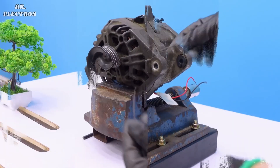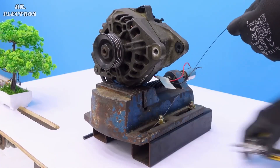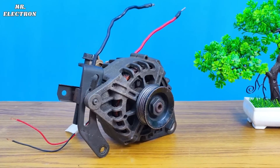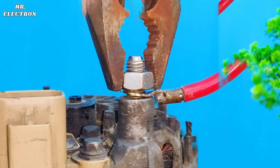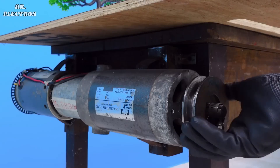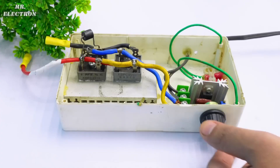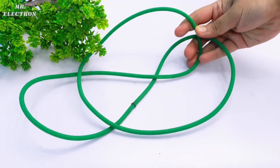Now let's install the alternator on the vice strongly to avoid any possible accidents, and at the same time use other kinds of lockings to prevent any possible alternator slippage from the vice. Here is some important information before starting the test: number one, the alternator is rated at 12 volts, 90 amperes; number two, I will be connecting the alternator by skipping the voltage regulator; number three, the driving machine will be a 2-kilowatt DC motor; number four, this DC motor will be controlled with a 2-kilowatt dimmer circuit bought online.